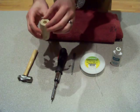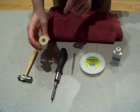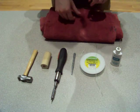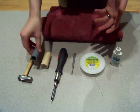About three-quarters of an inch to one inch diameter dowel with a small hole drilled in the end. If you don't have one of those or access to something to make that, you can use the end of a piece of PVC pipe. This is going to be used to tap the valve back into place at the end.